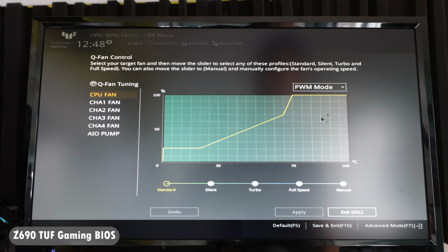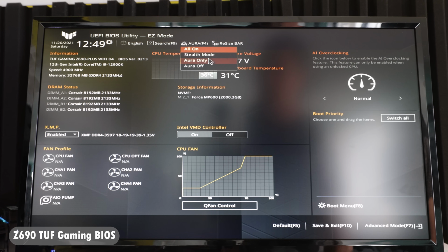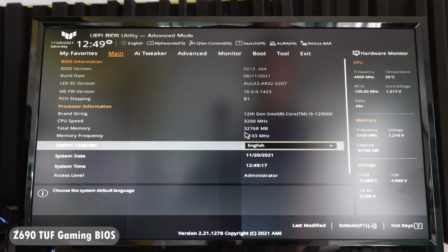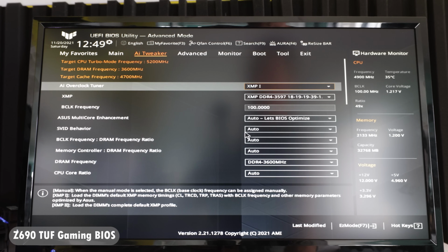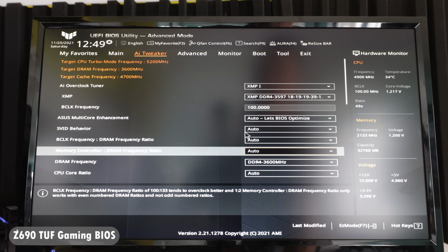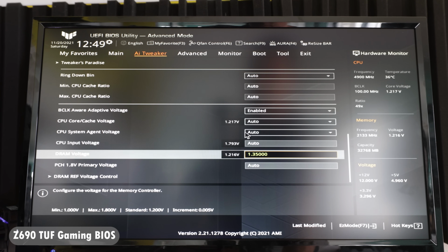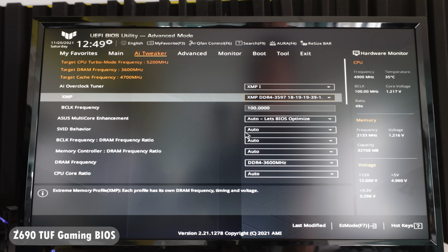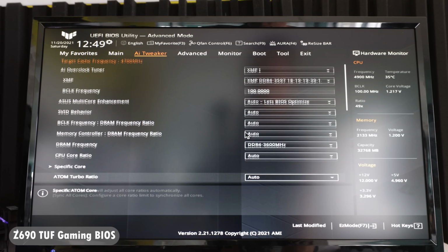Though speaking of the BIOS, ASUS do a great job of giving all the feature sets for overclocking, as well as the extra features like tweaking, locking in XMP profiles, and also tuning your PWM fan headers, which you get 6 of them included with this board. They're all 4 pins. Then at the top and the bottom of the board, you've got RGB control for 5 volt and 12 volt headers, which you can control in the BIOS in a basic function of turning on and off, and then in Windows you can use the software if you want to get a little bit more advanced